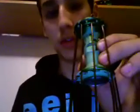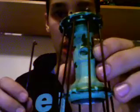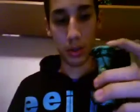Now this is where it gets kind of tricky. For the bottom flange, you need to make sure you get optimum valve hole clearance, or valve stem clearance. So you want to look at the spokes and see where they fall, where gravity stops them, holding the hub shell upright. Make sure the hub shell is straight up and down, and you want to go to the left. So for this one, it'd be right here. Because in order for you to have nice room to air up your tires, spokes need to be dropped correctly.